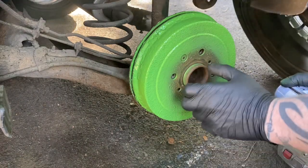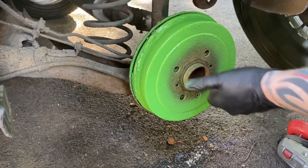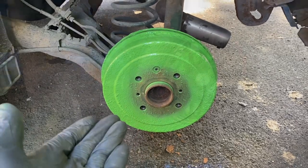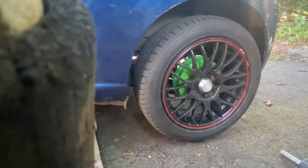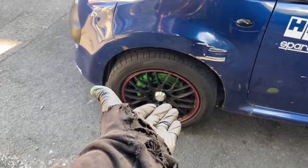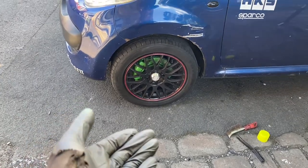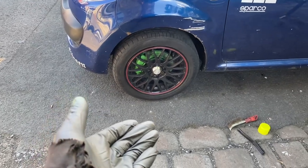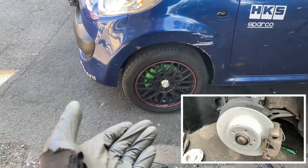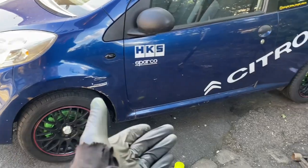As I said when doing the drum, I might not have the option of extra coats because I don't think I bought enough paint. Anyway, that is one side done. I'll say it's done when I drive it and the brakes get cleaned off. I see this quite a lot on Facebook - pictures of a disc that's been painted and everyone says 'why are you going to die, your brakes won't work.' This should work - it should just clean the paint off. In fact I fitted genuine BMW discs to my E46 a couple of years ago and they came painted, the full disc.